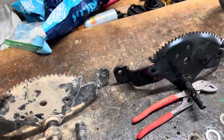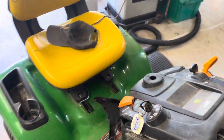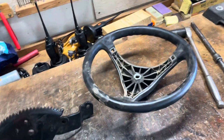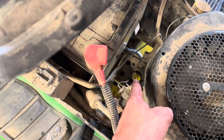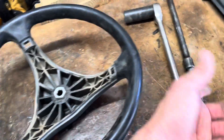It wasn't anything I looked up on how to do, but it wasn't that complicated. I'll just walk you through it. You're going to need to take the steering wheel off — that's pretty easy. That's just 15/16ths, and then you've got to kind of pry or pound it off. Then you've got to take off this, which is also 15/16ths, and this is seated down in that hole.